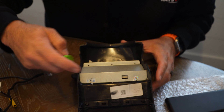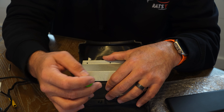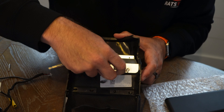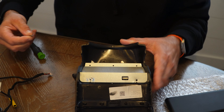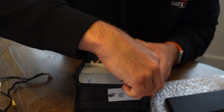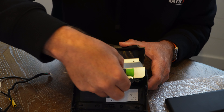As I was trying to pop this loose, I noticed that on this side there's a little sticker, and under that sticker is one more screw you need to get out, so you're going to have to peel that sticker back. It's a quality control sticker. Then on the other side as well there's another little QC sticker — they quite curiously covered up two screws that you need to remove. So there are five different screws total to remove to get this screen off: three screws along the bottom and two screws up top. Once those five screws are out it'll just pop right out.